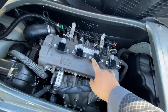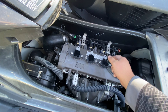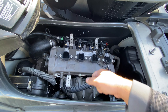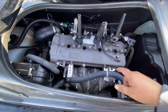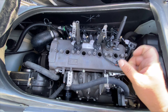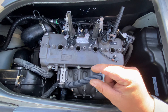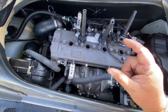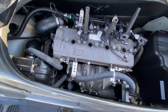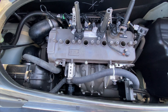These are the coil packs — we've got four of them, so eight bolts total, 10mm. Run the bolts out, pop the coil packs off, and just flop them over. The spark plugs are right underneath. I've got the coil packs off and now the spark plugs need to come out. I'm going to check the gap, which is the distance between the electrode and the little metal tongue on the spark plug, and make sure they're correct. 99% of the time I don't have to gap anything, but it's always good to double check.